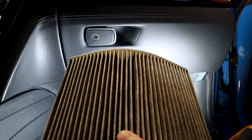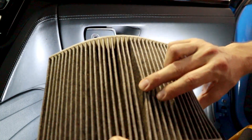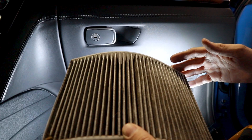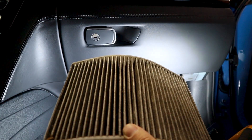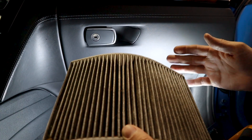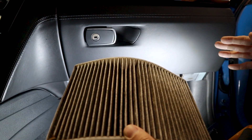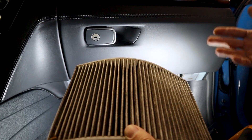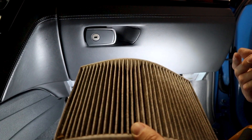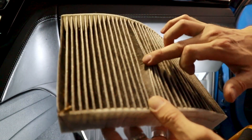There you go. Now if you haven't seen the inside of an air filter, these things can get kind of nasty. Particularly if you live in a high pollen area or an area that is dusty, maybe you drive through a lot of areas where they're doing construction. It is a good idea to change these things on a regular interval — you should do it about every 15,000 miles, but maybe more if you're susceptible to areas that would clog up your air filter more. Some nasty stuff in here.